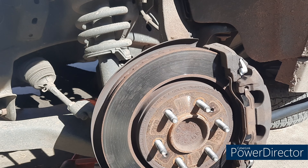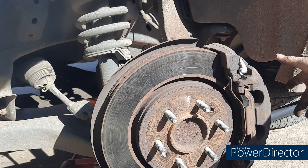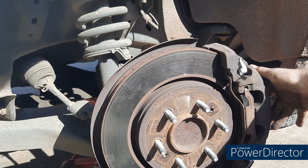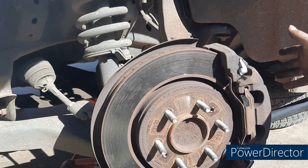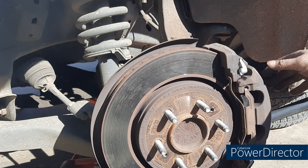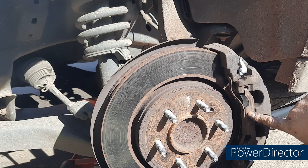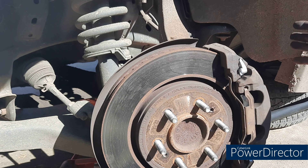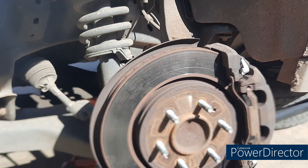That's basically it for a quick brake job — it doesn't take long when you have the right tools. The hardest part to me is compressing those caliper pistons. They make tools specifically for that, or you can use c-clamps — there's all kinds of ways to do it. That takes the longest: compressing the pistons so you can get the new pads in and slip everything back on.